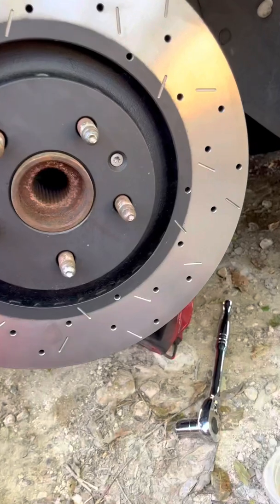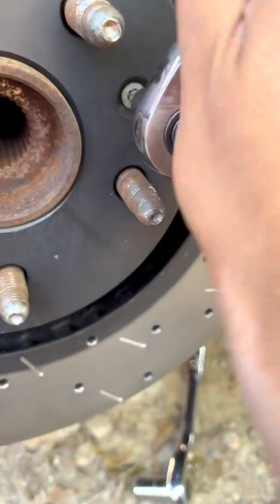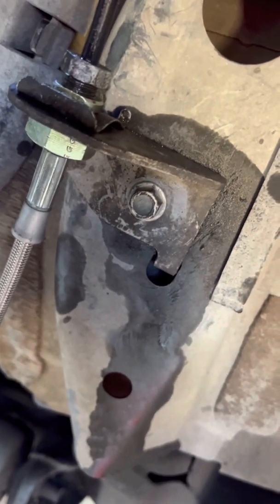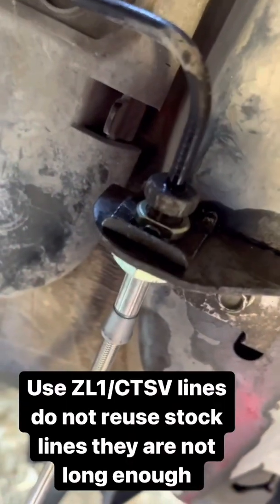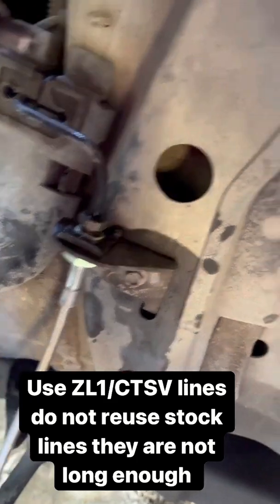Installing these is basically just the reverse process of what we just did — you'll be needing the T27 again. The next step is going to be doing the brake line. Basically, it's going to be this 13-millimeter right here to this top part. You want a 10-millimeter right here to pull that piece out. Once you do, the assembly will come out — then remove this clip with a little flathead. Just pry along that edge right there, and then do the reverse process to get it back in.